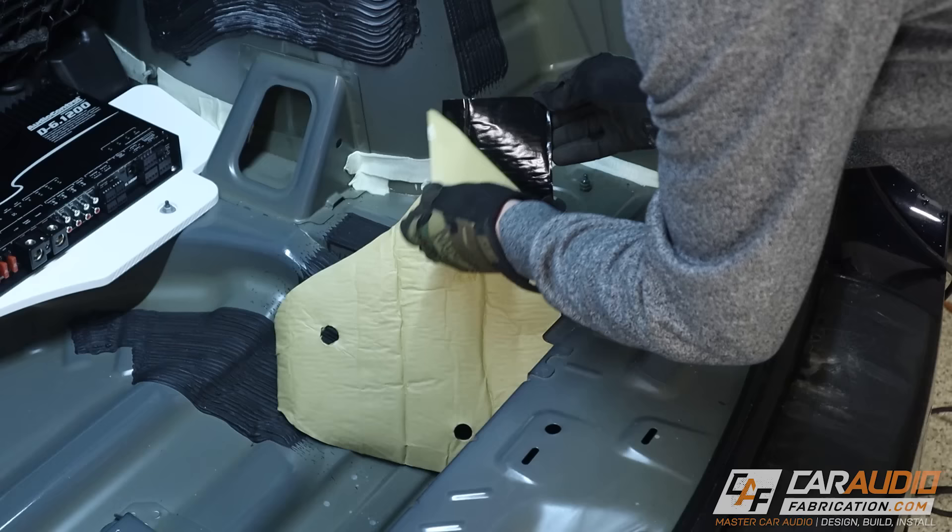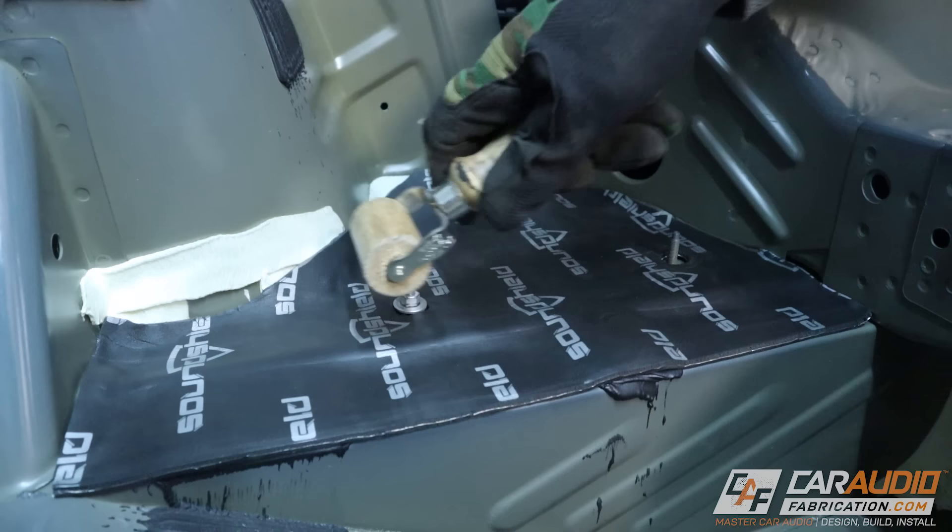Now I can remove that backing paper, put the piece in place, and a really important step is using a nice wooden roller to secure the material against the sheet metal. You can see how this can be a really time-consuming process, but the results are definitely worth it because it lowers the ambient noise level in the vehicle. We'll be able to hear more fine details in the music, which is really important for sound quality. And even if you're more focused on loud output and SPL, by applying these materials we're removing the ability of the panels to actually vibrate. Vibration is loss of energy — the more we can prevent vibration, the louder our system will be.